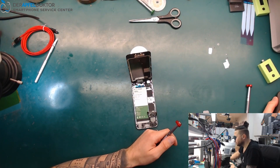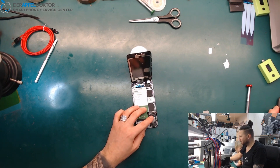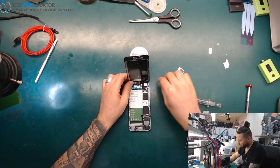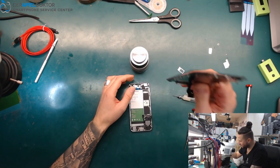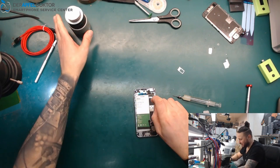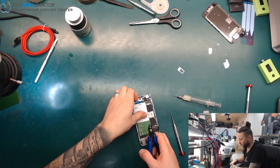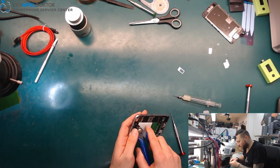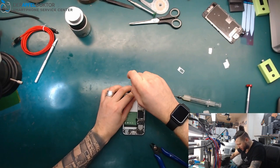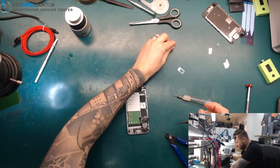Let's have a look if my little son can help us in this case. We just get out the SIM tray. For me now it's really important to see if the ICC pro - and this is a badly looking device - if it really told us the truth about the VCC main short. If we had an iPhone 7 here we'd have a direct test point for measuring, but on this device all the measurement points for VCC on the front are behind some coating or EMI shields.